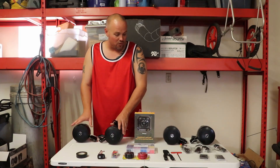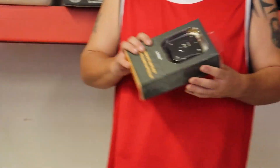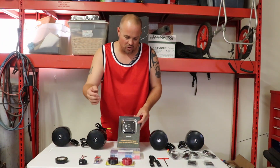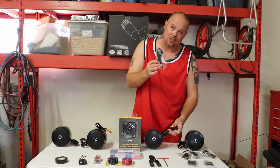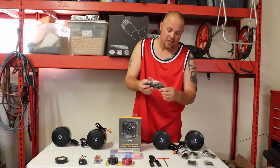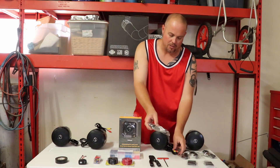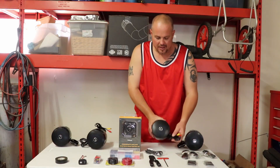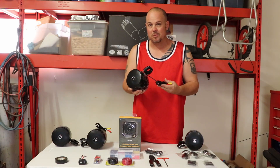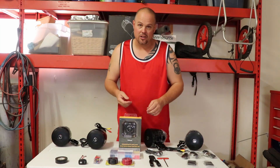So this is what we're going to install today. It comes with four speakers and a wireless Bluetooth control box. This box will wire into the middle of the center console and it'll also connect to RCA plugs. I brought some extenders — these are just simple RCA connector extensions, about 10 feet, so you can plug in and keep going since a lot of times these little wires won't reach all the way around your roll bars and under your seats.